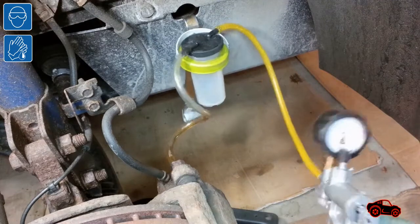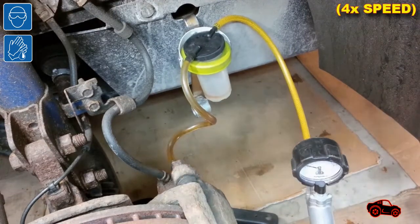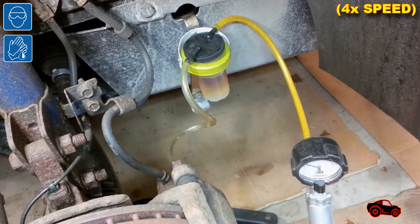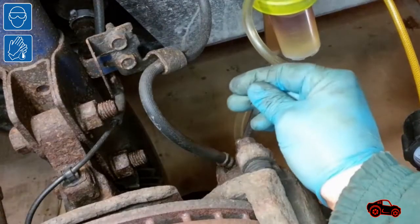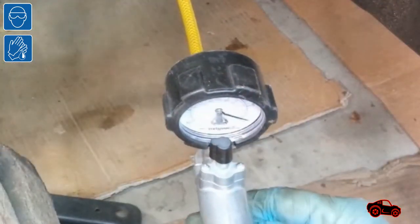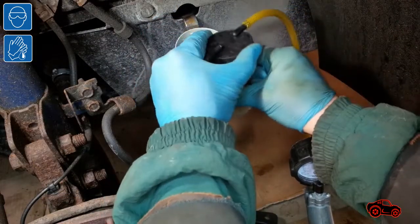The vacuum can be kept between 15 and 25 inches of mercury while the brake fluid is pumped out of the braking system. During the procedure, the jar is kept higher than the bleeder screw to siphon out the brake fluid and air bubbles from the system. When around two-thirds to three-quarters of the jar is filled with brake fluid, the bleeder screw is closed. Then the vacuum is released. Without vacuum, it's easy to unscrew the lid, then empty the jar.